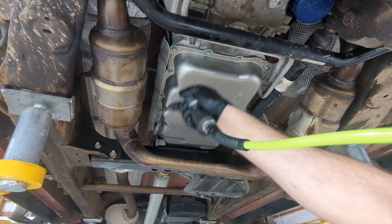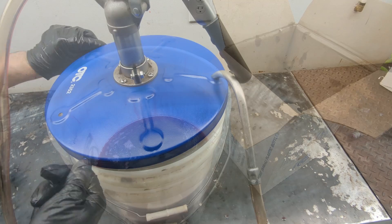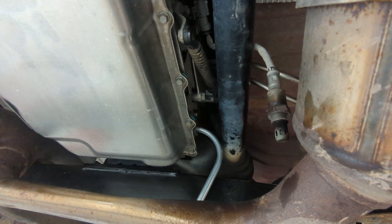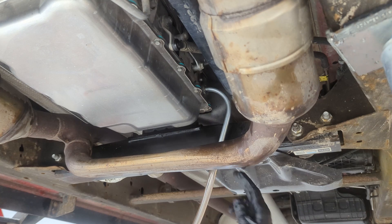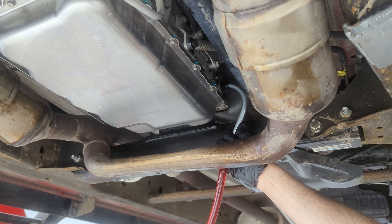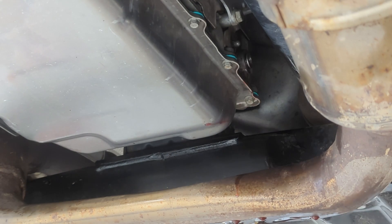Using a little bit of brake clean — which is flammable, though I'm not working with anything hot here; the vapors can be harmful. Then 8.1 quarts of ultra-low-viscosity Dexron ATF is what it calls for. I put nine quarts in my bucket pump since it doesn't suck up the full amount — there'll probably be about a half quart left in the bottom. I made a seal with electrical tape and pressed the bucket pump against it, pumped in the 8.1 quarts, and put the drain plug back in.